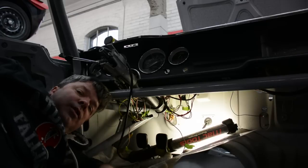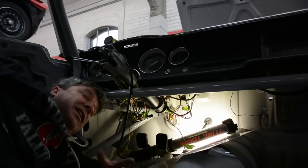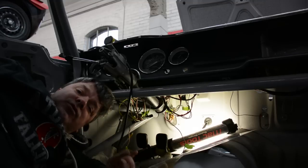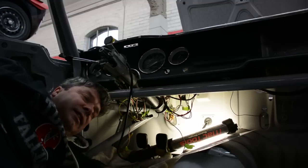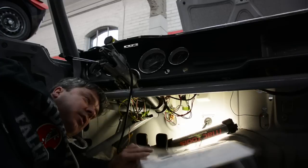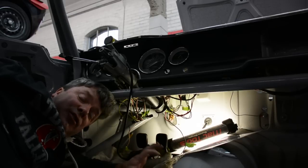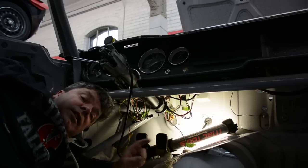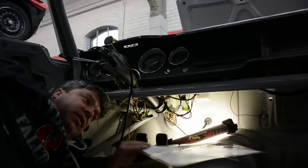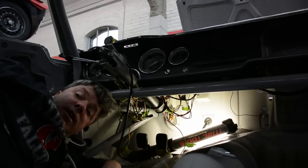It can really mess with you if you're trying to sort through the wiring in your car. A few other things you need to be advised on, but they're trivial. Sometimes there's a fuel pump that's electrical, sometimes it's mechanical. Just little things like that. So just recognize that you may have the right diagram for the car, but there may be some subtle changes to it. There's even sometimes color changes in the wiring that weren't on the diagram. So don't see this as the absolute accurate thing, but it is certainly a good reference to help you get through the wiring challenges on these cars.